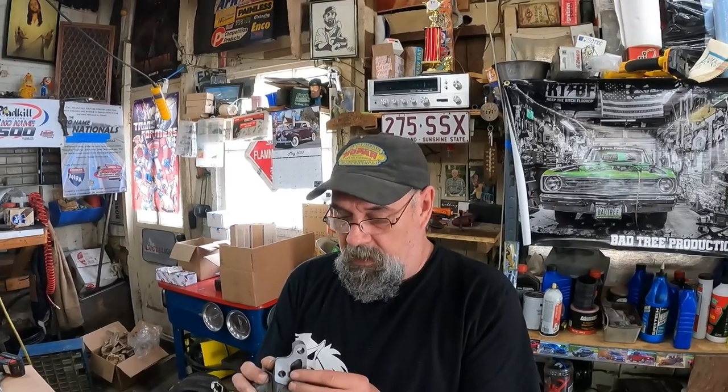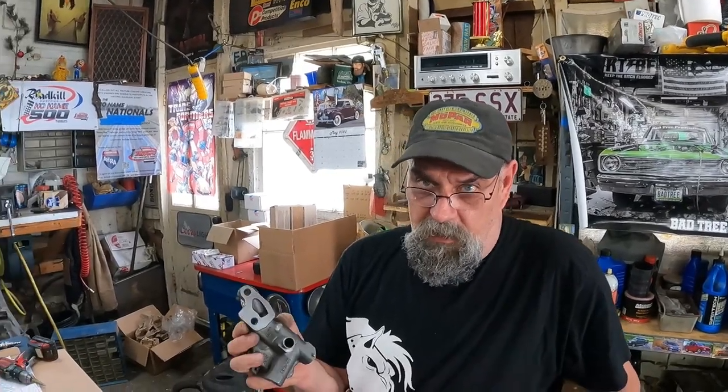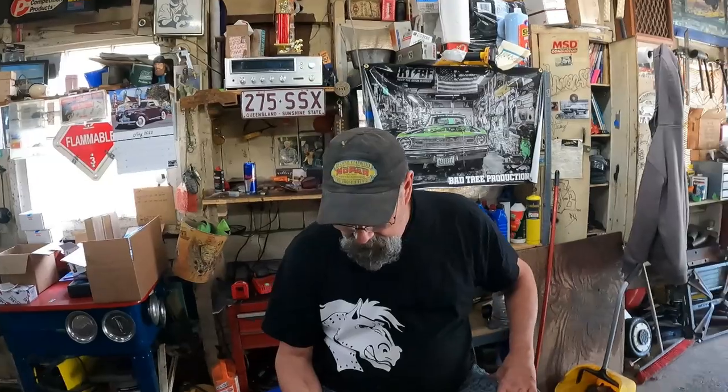Right. You can actually seal this too. Where it actually attaches to the engine, you can seal this part here. And I think from the factory they don't even put a gasket here. But when you order a pump, they give you a gasket. I just wonder if it's because the tolerances from the factory are probably finer, and they made it smoother, so it didn't require a gasket. I don't know. But you can use the same method on this part here too if you feel you need to. So anyway, we'll clean it all up. And so that's what Jay's working on.